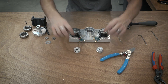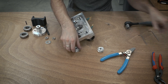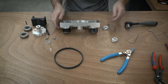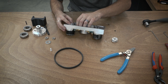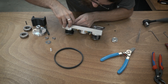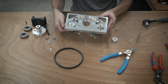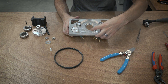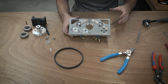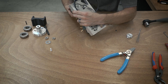Now it's time to add the two pulleys. I've already ground down some flats in these shafts for the pulleys. The height of these pulleys is very critical — there's not a whole lot of extra room so they need to kind of sit right in the middle. They need to stand off of the bottom a little bit but not interfere with the top because that's where the armor plate goes over. That looks good. And of course I forgot to put on the belt, but it can kind of go in after the fact.